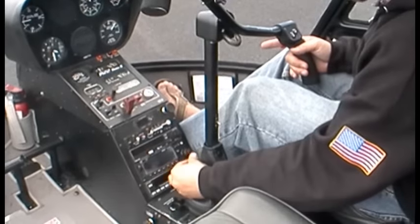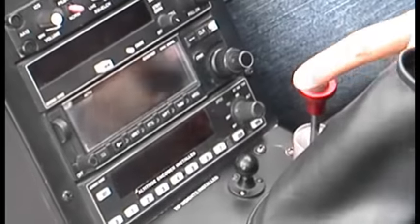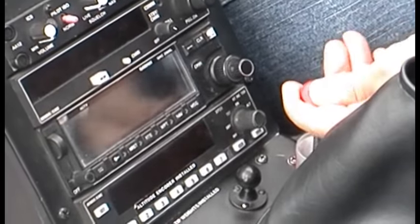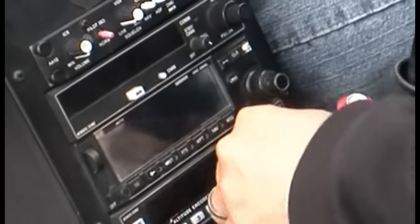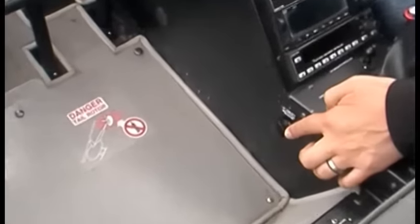Robinson recommends you always reach around to the left to do this control — don't reach through here. The reason is there's also the fuel cutoff control here. People have inadvertently gone to pull their trim and instead pulled the fuel cutoff, the fuel mixture to the cutoff position, and shut the engine down. So always reach around to the left for your trim control. This little knob here just adjusts how much pressure this trim puts in — generally you leave it where it is.